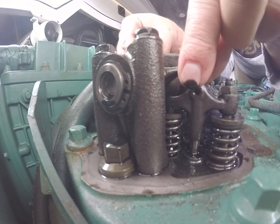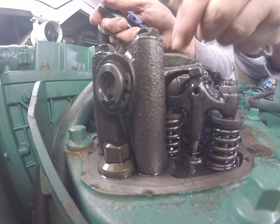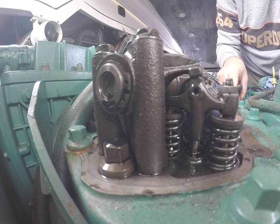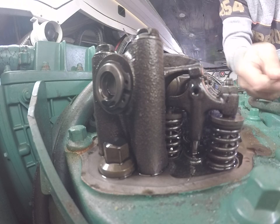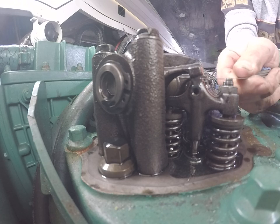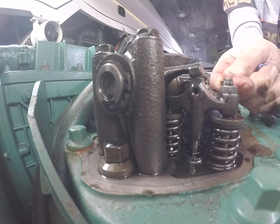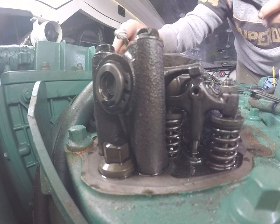So that's those ones done. Now you do your main clearance here using these adjusters, which are a 13 or a 12. Let's see how far we are out now that I've done that. Not too far actually — pretty good I'd say. In fact, I might back that one off a tad because it's a little bit tight, but it's not bad at all really.